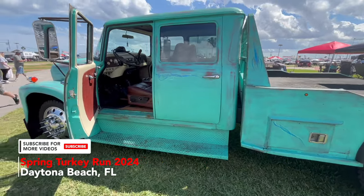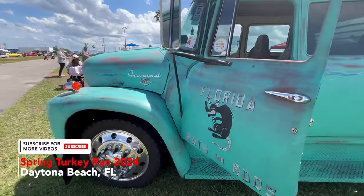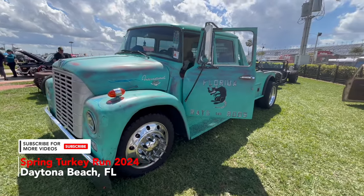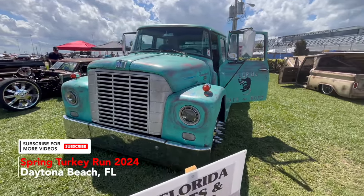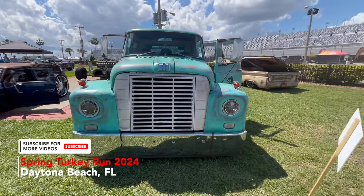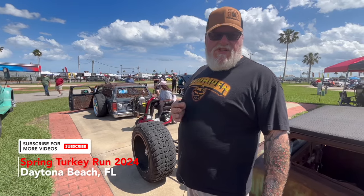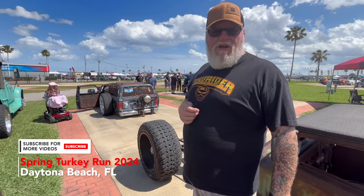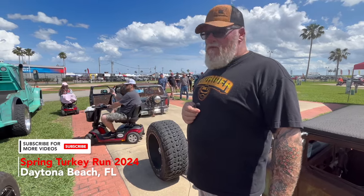And I bought a '93 Ford ambulance, and I stripped it all down to the chassis and the engine, pulled the automatic out, put a 5-speed in it, and mounted the cab onto it. It already came fully air ride, front and back. We wanted to use it for a tow vehicle, so it's got all King Ranch interior. It's got the 5-speed, air conditioning, and a sound system in it. We pull the other two vehicles with it, so we wanted to be comfortable. So we did all King Ranch, and all the electric seats and everything in it worked. And it's a really nice truck.